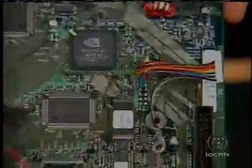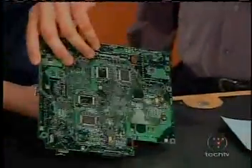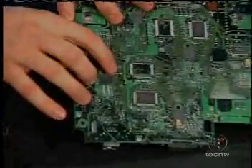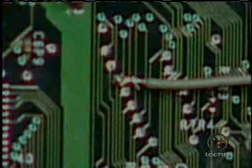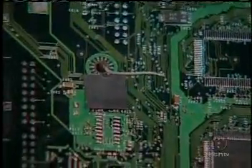There's one on the back — let me show you. This little solder point is called the D0 solder point, and that's the tiny one. If you accidentally get solder on any of those other dots or on the lines there, you're going to break your Xbox pretty much. So you have to know what you're doing.